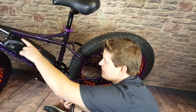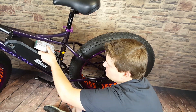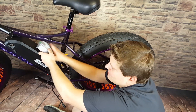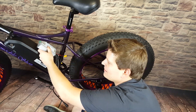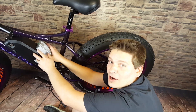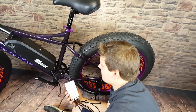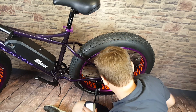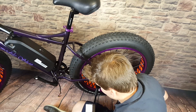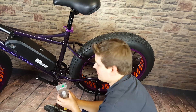As far as mounting the controller, we have a few different options. We talked about putting a bag here for the battery earlier, and if you had that bag you could tuck the controller right inside the bag. I usually like to put a piece of foam or something in between the battery and the controller, just so you don't have this hot object sitting on another potentially warm object. But we're going to mount it into a controller box. If you don't have one of these, what I'd recommend a lot of the time is just to mount it to the frame somewhere.